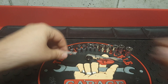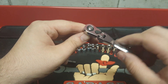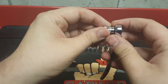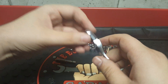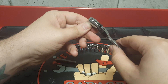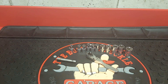So it's 13 pieces and it comes with the quarter-inch drive flex head ratchet. This ratchet has 72 teeth and has a push release — push it that way and it locks in place and won't come out, then to release the socket you push the button and pull out. It has a 5-degree arc so you only have to move it 5 degrees to get a click in, which is really good especially in tight places like the interior of a car.